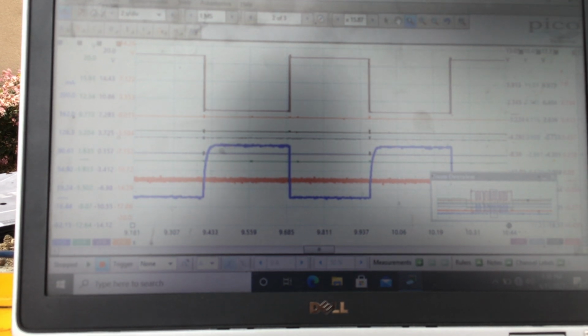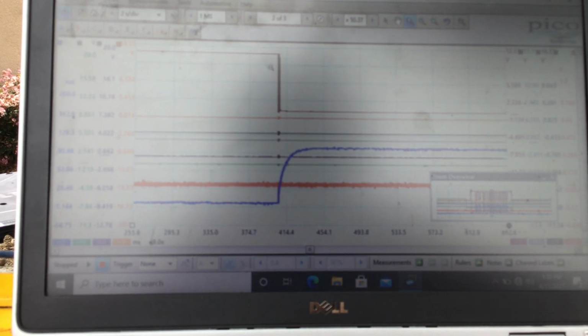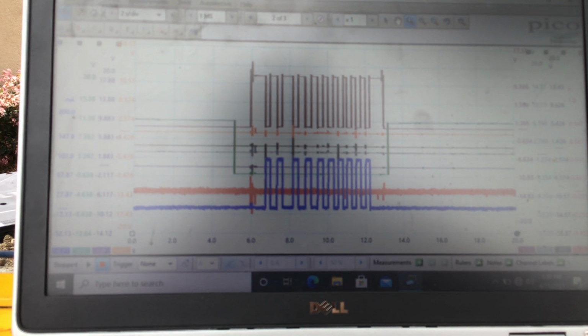That voltage is going low. That's our current to the key interlock solenoid. So anyway, just take a look at that. You can see the relationship between those. Now I'm going to go back and do something like this, but I want to do a relationship between the brake switch and the shift interlock and watch that action reaction.